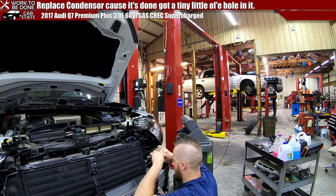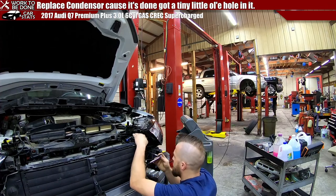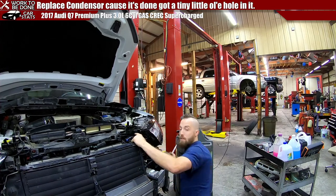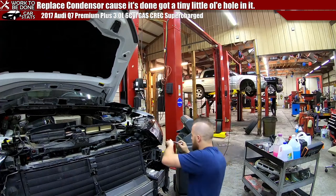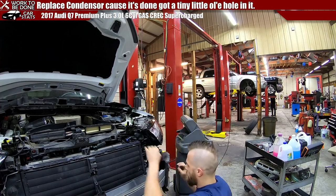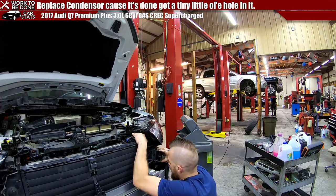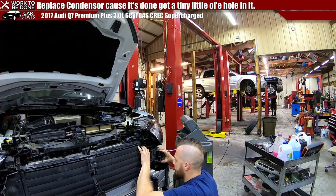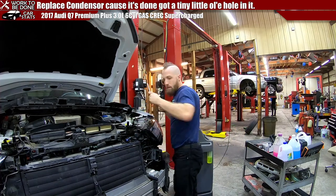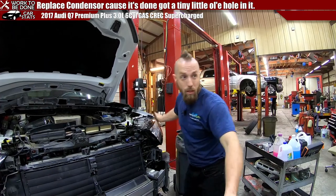See, like right now my witness marks are a little high. I don't know why. Come on down. Did I tighten you guys up already? I did. Loosen that one up. So when you're doing the headlights, you do want to make sure that you give it its attention to make sure you get it in there right where you got it out from. I don't know if that's gonna be possible in this. Oh, the washer can move a little bit too. So, we might be doing pretty good. There's that one. Let's go ahead and tighten up the top one.